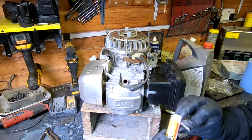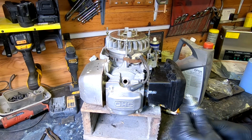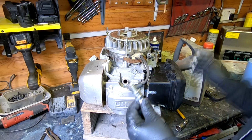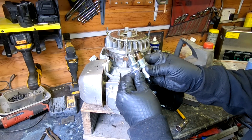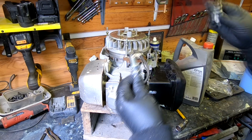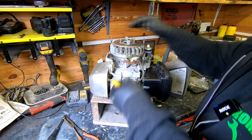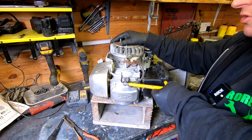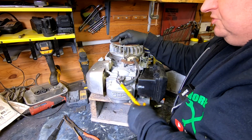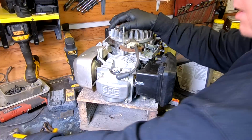Right, okay, so let's get that put in. There we go, brand new one. Always like to check the length just before I put them in, in case someone's put one in the wrong box, you see. And that does happen sometimes. So there we go, the lengths are both the same. Put it back in, straight in. So give that a little nip up. Don't forget they've got a compression washer on there first, folks. So you'll feel a tightness, and then it will come to a sort of stop like that, and then just give a little nip again, and that's it. That's all you need. Once that washer's compressed, I don't need to put that on yet.